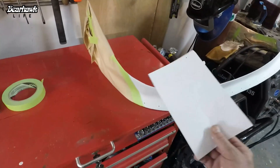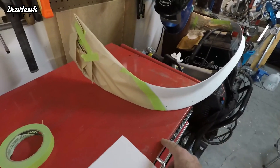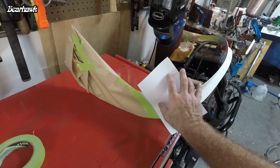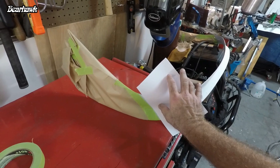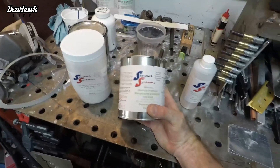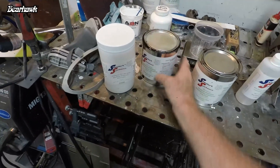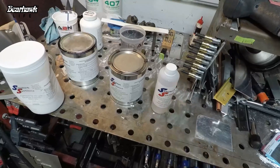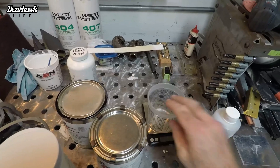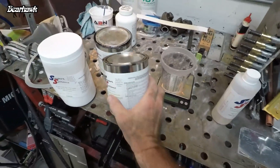The windscreen fairing portion is also going to be flat black, so all the areas not getting painted have been masked off. Something I've learned about getting lines straight, especially around a compound area: if you just take a piece of paper and lay it over the area, the paper can't stretch. So if you're not sure if the line is straight, use a piece of paper - I did that on both sides and it helped a lot. Here is the Stewart Systems EcoPoly - this is what I'll use for the top coat - and this will be the flattener. I'll also use some distilled water, and everything will be weighed so I know exactly how much to add for each part.